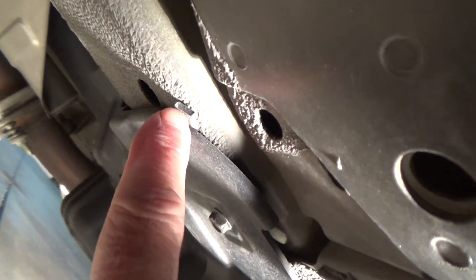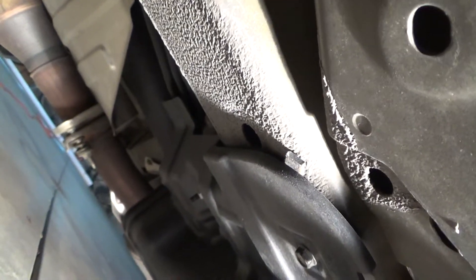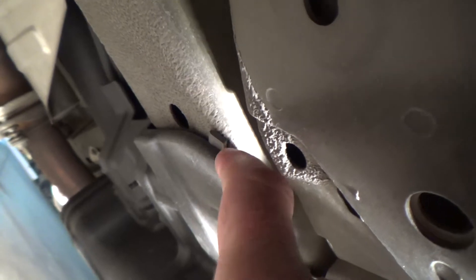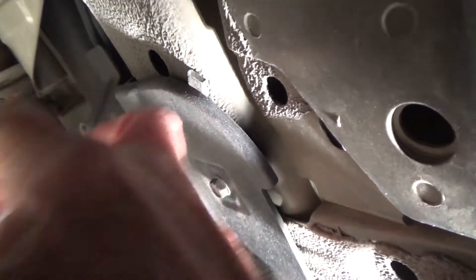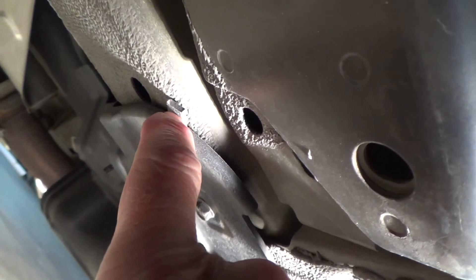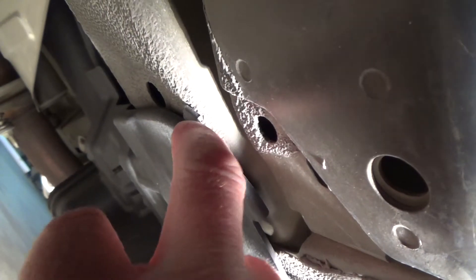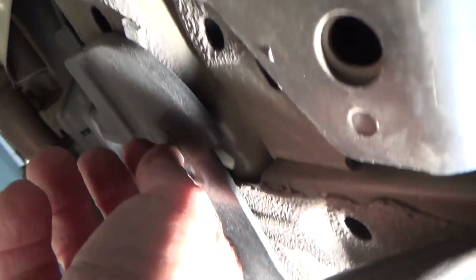Right there, that's just a little piece of rubber. I save little pieces — hey, maybe I can use that later. I had it over by my toolbox, loosened this up, and put it in there a little bit thicker than the gap, then re-tightened the bolt. I made it pretty tight so it wouldn't bounce out. I could have put two rubber shims in there but only had room for one, so I cut the piece off, shoved it in, tightened it up, and fixed that squeak.